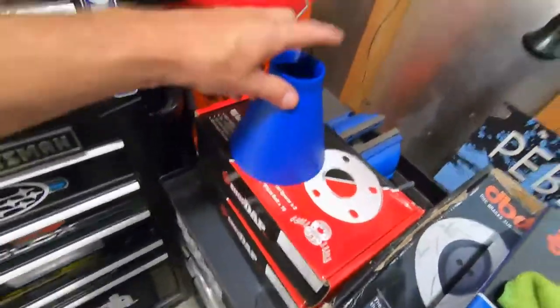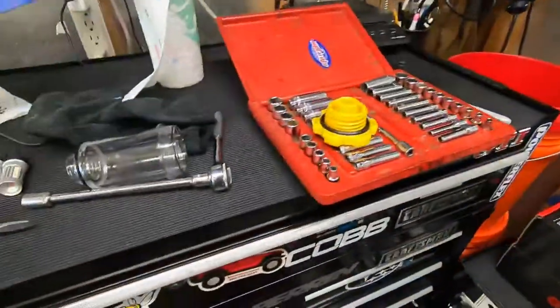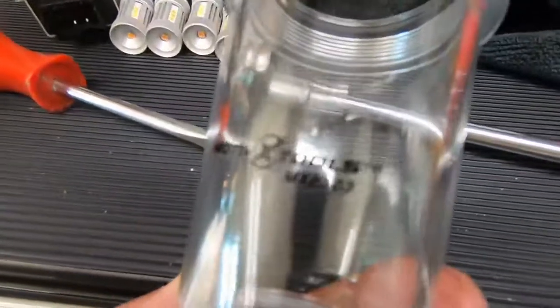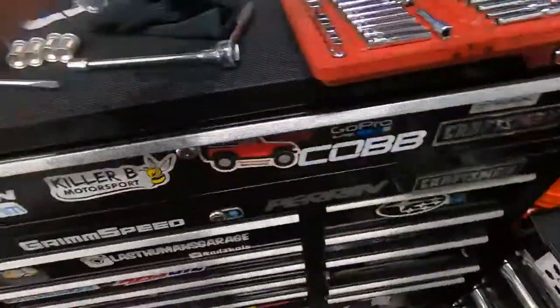One last thing: the parts for your Motive funnel. The top is universal across all of them. The middle part number is 2303 — they also have 2101, 2301, and 2302, so 2303 is correct for the bottom splines on this application. Then you get the Subaru adapter which goes right in the bottom. Between the three different types I have in my garage I could probably cover most cars. I'll throw a link in for the Motive Tools in case you want to look into one — it's probably a lifetime funnel. I clean it off between each use so it stays nice. That's about it, see you later.